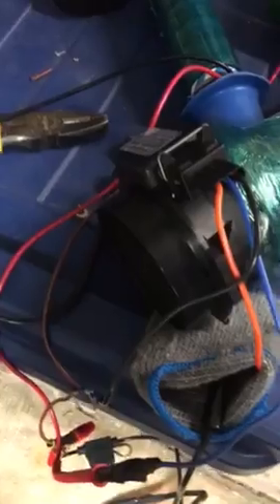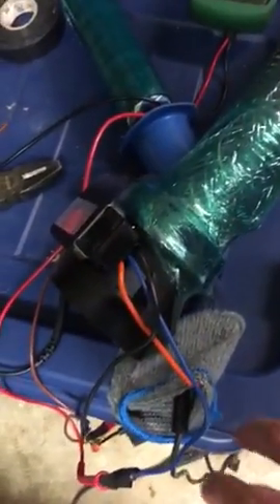So there you go — that's a test bed, that's the way to test a mass air flow sensor. You have to power it up with 12 volts. I've tapped the power out of the front end of the 911 and gotten it there.